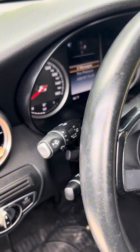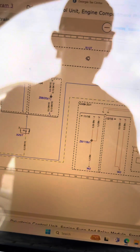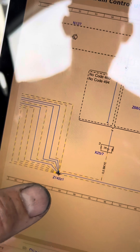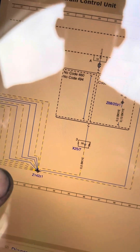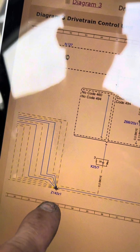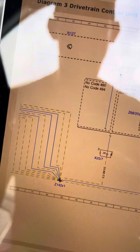So that's how it goes sometimes. What I'm looking for — this has been in an accident. Let's find some wires. I'm trying to find this Z splice because I don't have continuity. And I found it, but now I've got to determine where that location is. Look at all of these other LIN buses coming through here. I believe when I find that, I'm going to solve a lot of problems — if I can find it, I will.